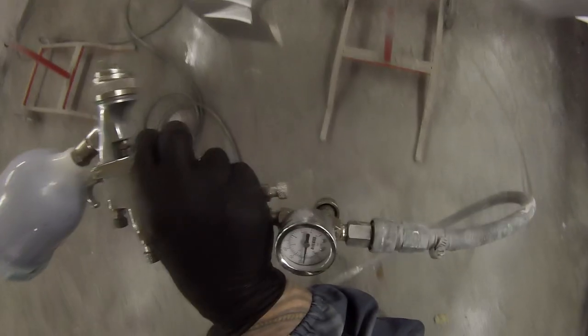Next I'm onto the blue — you can see the green's done and I've moved onto the blue parts. I also primed up that front bumper bar first because I didn't want any overspray to land on something that's already been freshly painted. You've always got to be thoughtful of which way the spray booth airflow goes. In my spray booth it comes in up the front where the green stuff is, then blows down and goes through the filters at the very back where that bumper bar is. So I started with the bumper bar, then did the green, then the blue — and even when doing clear coat I still like to work with the flow of the air.